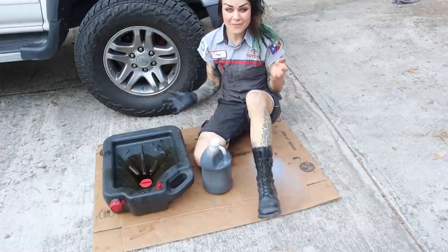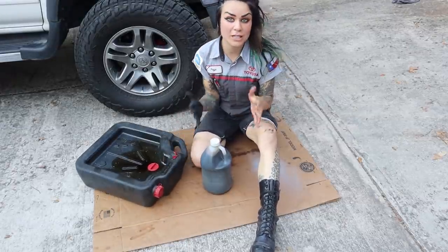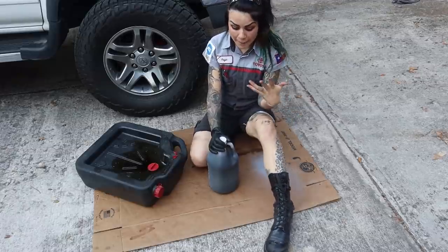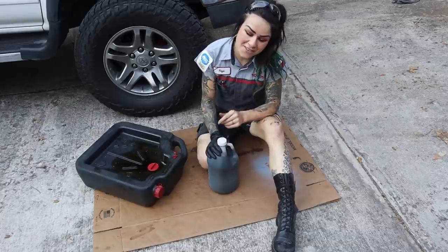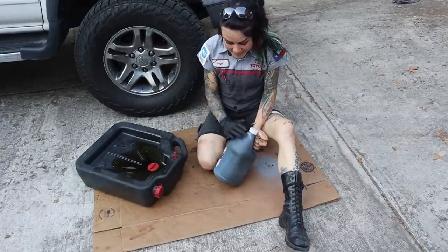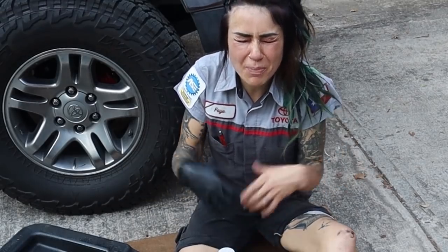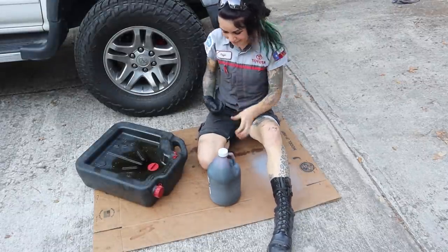Now that we're done with our oil change, we've got all this dirty oil. What do we do with it? So what I do is I collect it in a container like this. As you saw in my drain pan, it's great for collecting oil and makes it super easy to pour it into a container. In my neighborhood I'm able to put these into clear containers and the city does recycle them. However, you can also bring these used jugs of oil back to wherever you got the oil initially — an O'Reilly's, AutoZone, or Napa; most of them take used oil. Also a local oil change place like Take 5 or Valvoline will also recycle your used oil. They just have a limit on how many gallons they'll take in a day — our local limit is 15 gallons. I always like to save something like a used washer fluid bottle that has a really tight cap, so you're not spewing oil out while driving to drop it off. Just don't use a milk jug where the top will just pop off, because then your car is going to smell terribly.